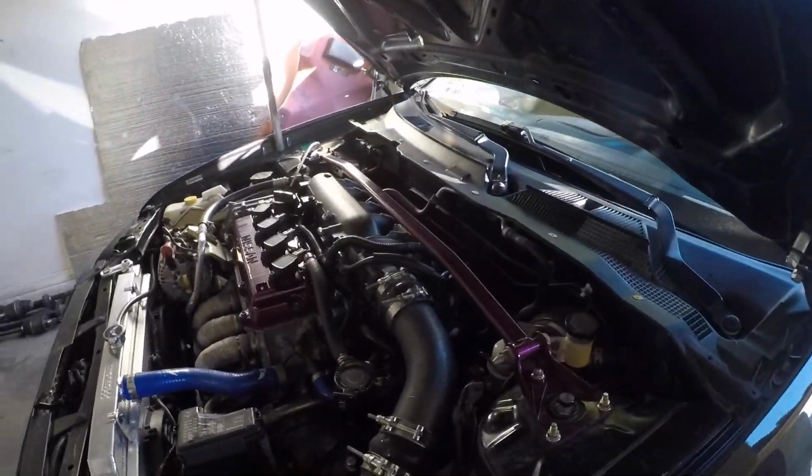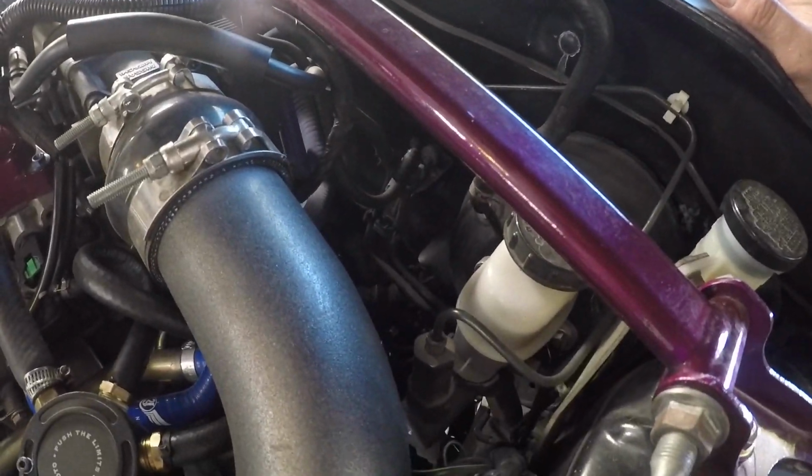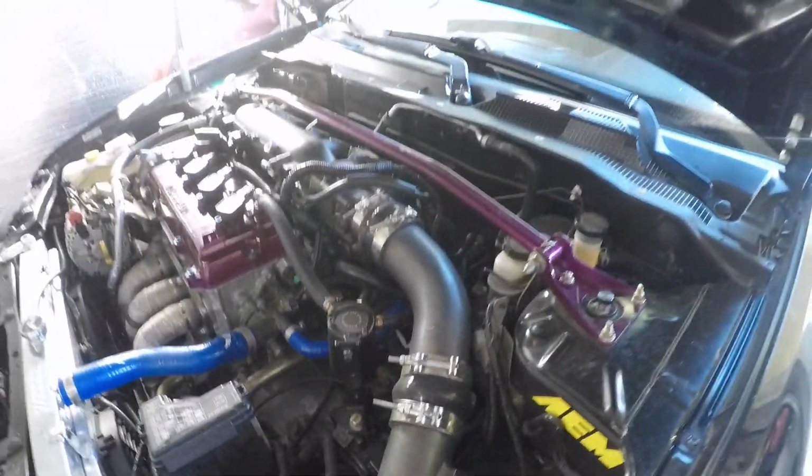So the steering rack, we gotta jack it up, reach down there, grab it and remove the wheels, right? Yeah, just gotta pop the wheels off. But grab it at that yoke and give it a little twist. The column, you should be able to reach it. Oh yeah, it does have some play. I don't know if it's the column or the rack, because the rack's only 2 years old. But it's been like that for a little while now. With that same play, if you look at the steering wheel when you do that. Oh yeah, it does move the steering wheel. So I don't know if it's column play or rack play. Sounds like it's gonna be column.